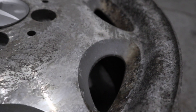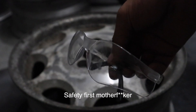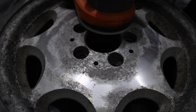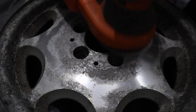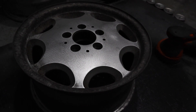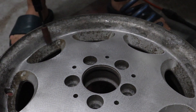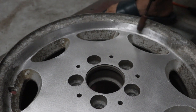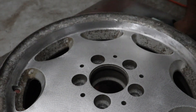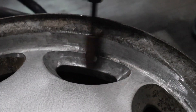I first looked at the rims, and they got a lot of corrosion on them. There's no way I'm going to be painting over this — it's going to show right through. So I had to clean all that up first. I had this orbital sander, and the surface of the rims are very flat, so I can use it — it will save me a lot of time. I went and sanded down each of the faces of the rims. It ended up working really well because it was all one texture at the end. Then I used a die grinder for the edges, the circumference area of the rim, because that was kind of hard to reach. I spent a little bit of time, but I wanted to make sure all the corrosion was gone or at least smooth, because I didn't want any of this to show in the paint.